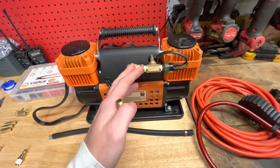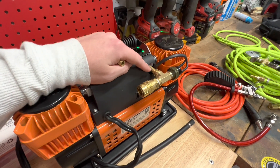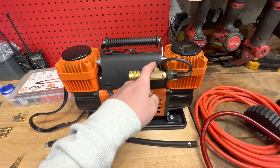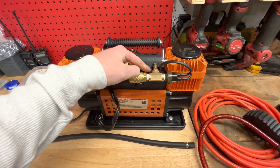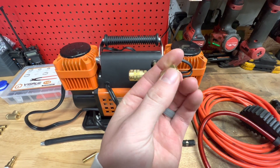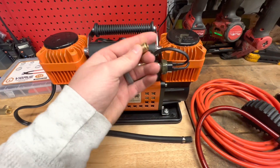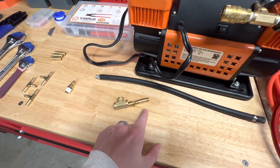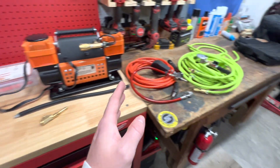So it's an eighth-inch, one-and-a-half-inch nipple, and then you need what's called a bushing — it has a female eighth-inch and expands it to a male quarter-inch. That allows the nipple to convert from eighth-inch to quarter-inch. So that's how you connect these fittings and how that works. Now we'll move on to the pieces needed to make that.